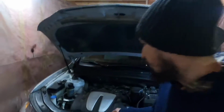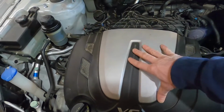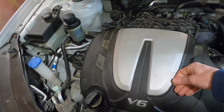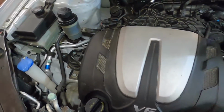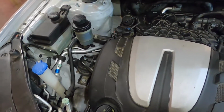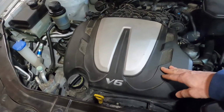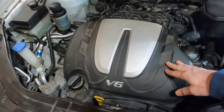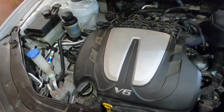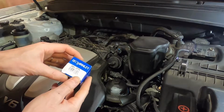They all have the oil pressure sensor, unfortunately, way down under this whole intake and everything. This has all got to come off, and it's way down there in the valley. So I'm going to show you how you know if you have this problem for sure, and then we're going to go through the steps, step by step, removing what needs to be removed, getting to the sensor, and changing the sensor. So I went with this aftermarket sensor.